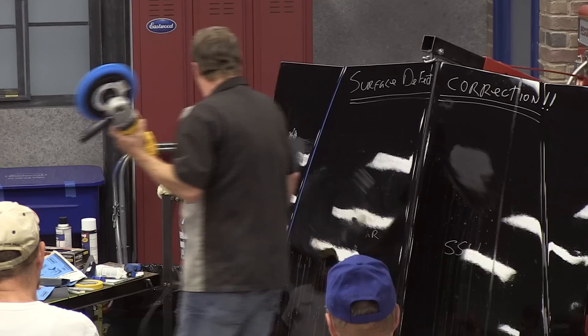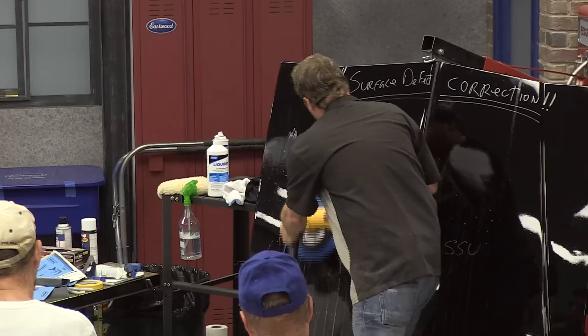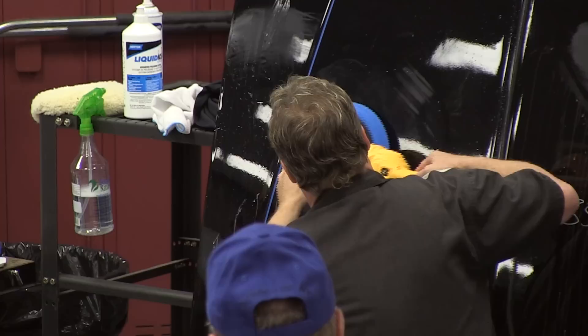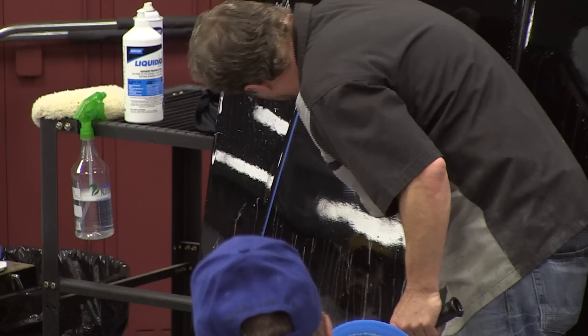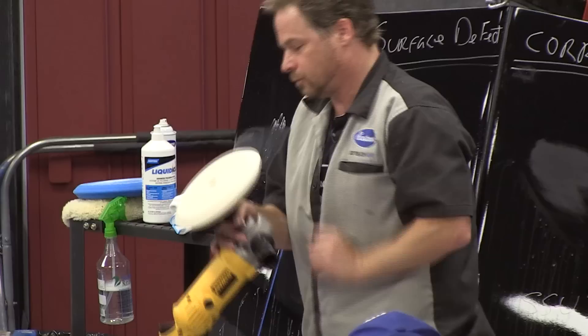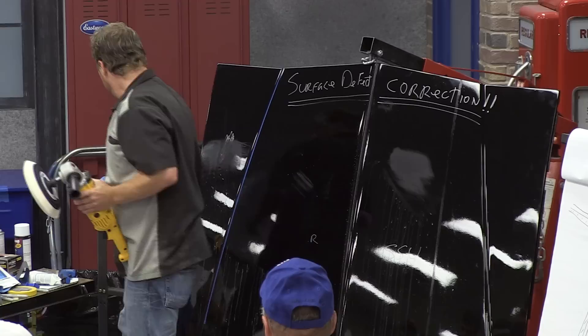We've got a little bit of surface lube on here. Now we go back with the same compound — liquid ice. Just like polishing aluminum, the shinier it gets, the less it takes to make it even shinier. I'm rubbing a little bit. I've got a haze over top of that — ready for the next dollop of compound. I'd normally do three applications, but for this demo I'm moving on to demonstrate the system. So we're done with the intermediate step. The next one is a much softer foam pad — the white foam. Liquid ice only has three pads in the system, but you can go with a black waffle pad that's even finer if you need to.